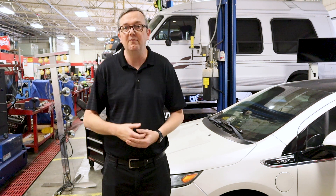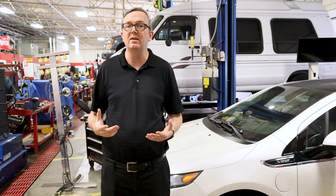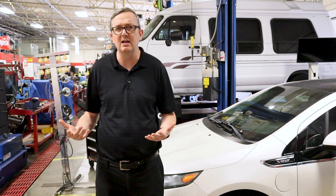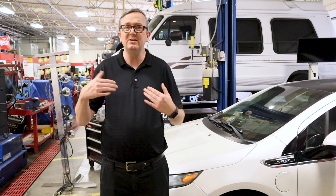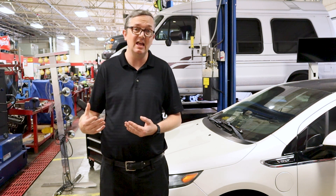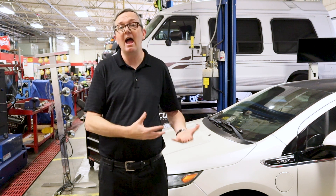It's working with the exception of the miles — the odometer no longer shows the mileage — but other than that, every other feature is working. I'm sure there's some way you can probably reprogram this. But with a car like this, I've got 275,000 miles on it — I'm not really worried about the mileage display. I can always check it with the scan tool if I need to. If your board goes out, you're going to have this problem. But if it's just the LCD screen and your old board is working, you can swap one from a known good unit and you'll have your mileage and everything. You won't need to recode anything — it's going to work perfectly.